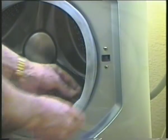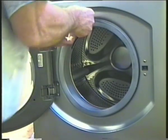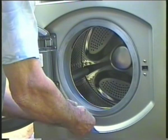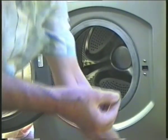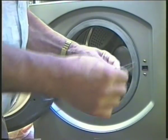Feed the seal round the front panel so that it's even before you start fitting it, otherwise it will go on wonky. The inner lip on the seal fits into the upturned groove around the door opening, which is held in place by a retaining wire. If you run a small amount of washing up liquid between your fingers then slide the retaining wire through it, this will lubricate the wire and allow it to fit easily.